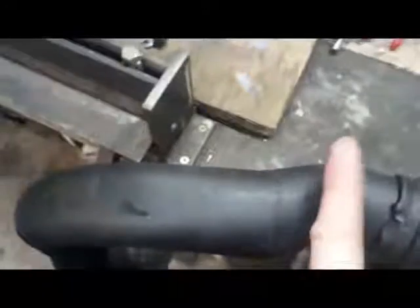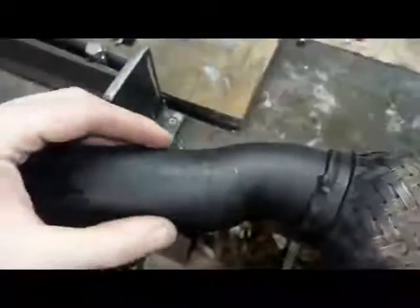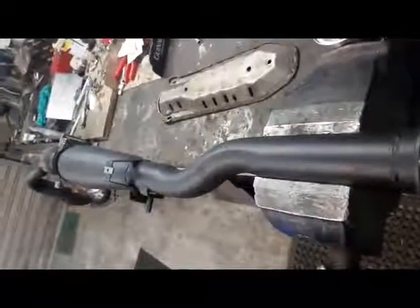Back up to this section here — flexi joints and the last bit of the exhaust. I cut it off and put in a bend to make a slight stagger, which was to make this part of the exhaust avoid the gear shift mechanism, which it does nicely. This part going in and out like that brings this section of the exhaust back into the center of the car. I think I'm good to go now — next thing is to fit this and forget about it hopefully.